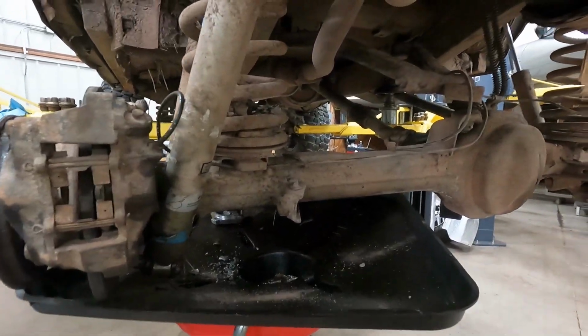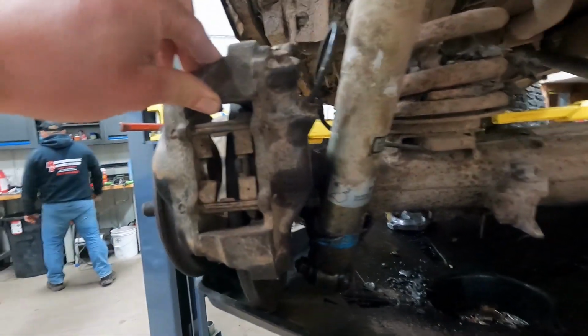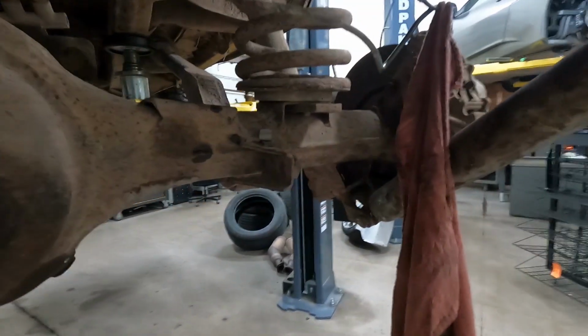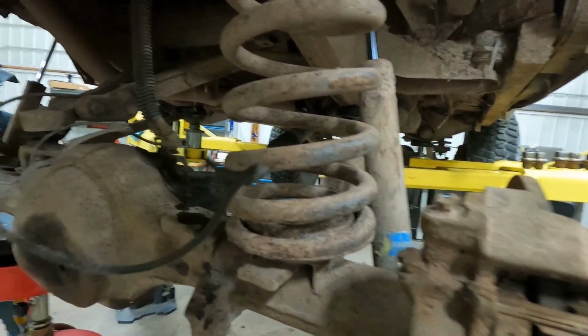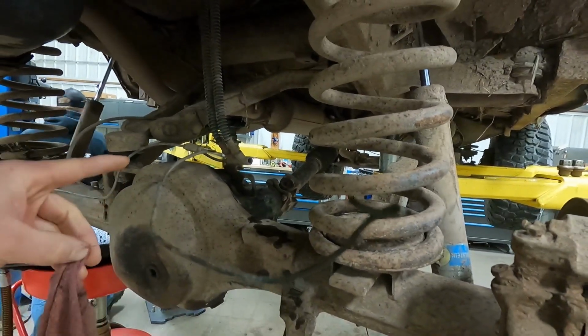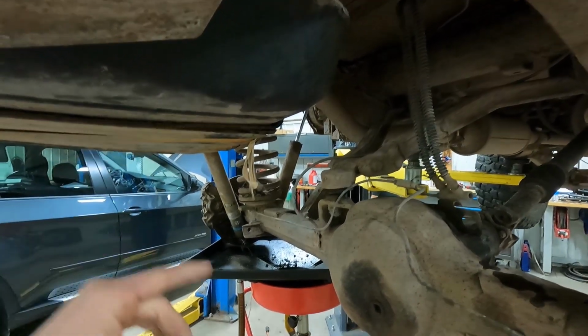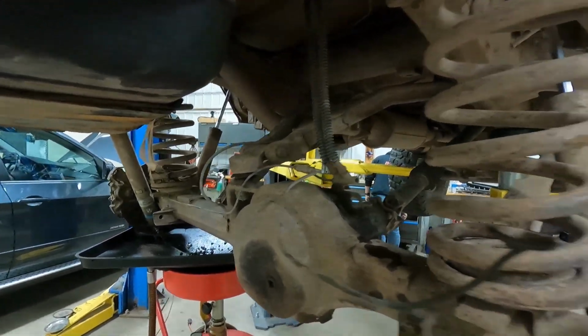So that's the axle situation on the brakes. Passenger side, it's kind of not connected. We only got one bolt in there and one pad, missing a pad. Oh, that's the driver's side. On the passenger side, it appears that the brake line got caught on something and ripped off of the caliper. So we will make up a new brake line for this side, slam a pad on that side, and Ted is sorting what to do with the axle because that is chooched, as they say.